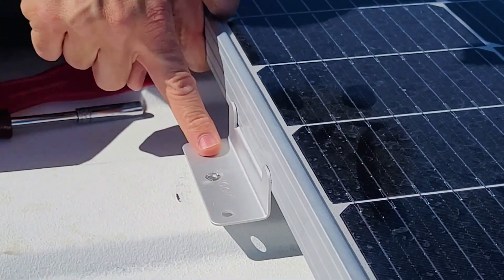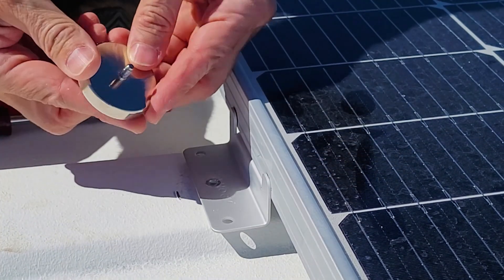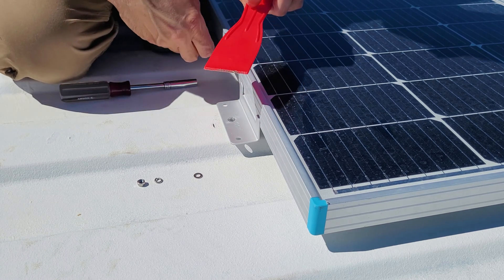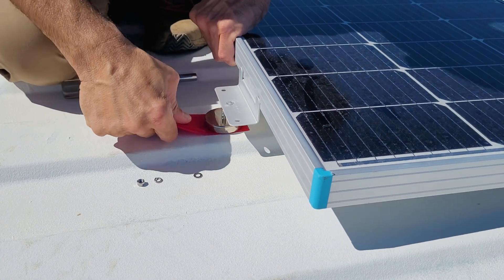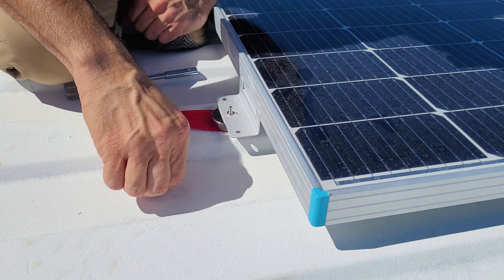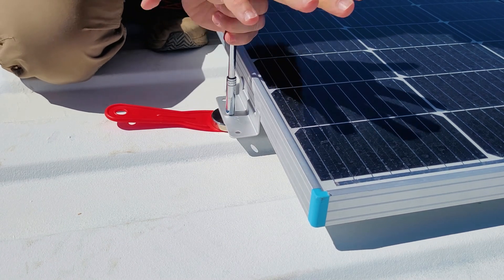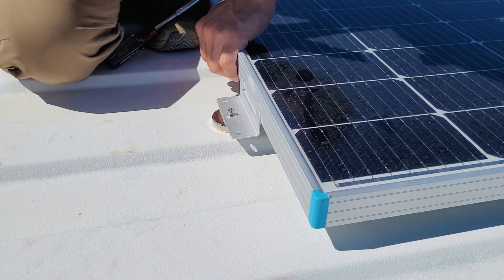Here's that Z clip. I drilled a hole in the middle of it because that's where the ridge on the top of my roof fits, and it has to fit the diameter of the threaded stud that comes out of the top of the magnet. I use a plastic scraper to get it in place — plastic being important because it's easier to get out, and the extra distance between the magnet and the roof keeps it from sticking too soon. Then I throw some washers on and use a nylon lock nut, tighten it up with the right socket, pull out the plastic scraper, and it sticks to the roof.